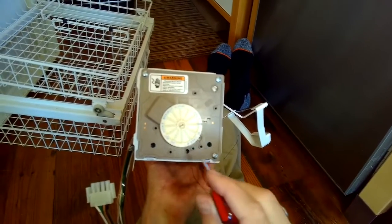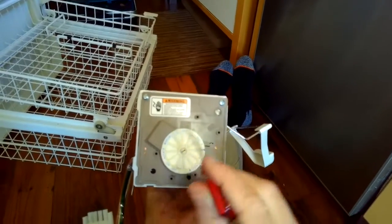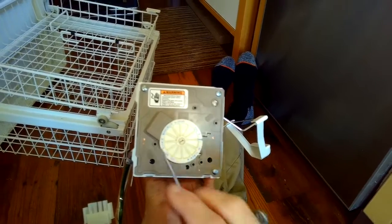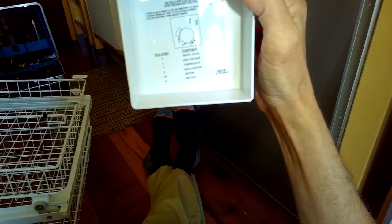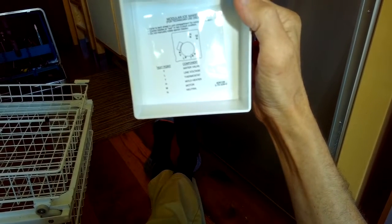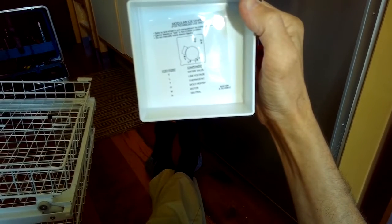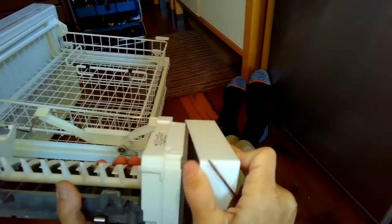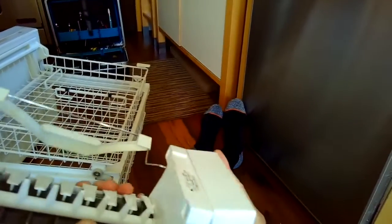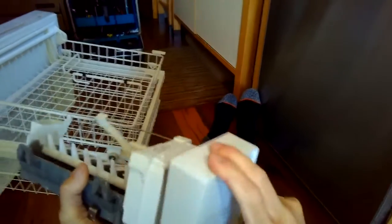and if you do that on an ice machine that's hooked up, it'll run a cycle. It'll put the water in, it'll turn, it'll harvest the ice, and it's one way of testing to see if your ice maker is working. With this one, when I did that, I didn't get any result because the water couldn't flow down because there was a big ice gap. I had to get rid of that.